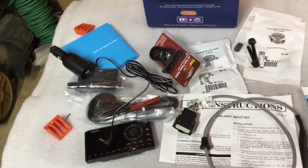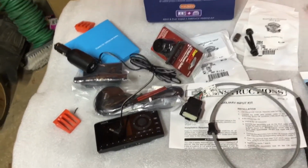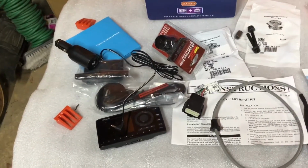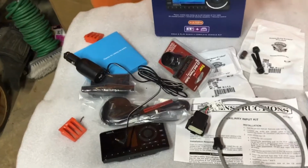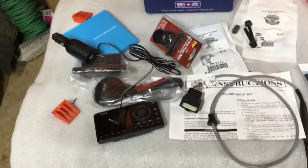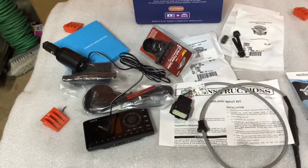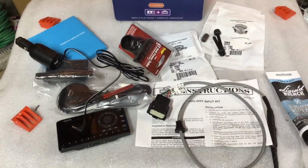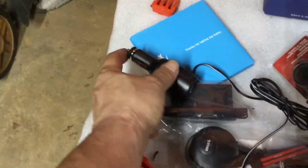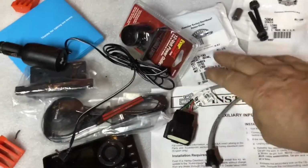And on my 2009 Road Glide, when I installed this basically the same way, I just tapped off on the 12 volt, well, they call it a power outlet. It's the cigarette lighter in the fairing to power the satellite radio, because the jack is 12 volts, but the cord itself going to the docking station, I think it's 5.5 volts. So I could do one of two things. I could take the housings off of this and just hot wire it right to the thing, or I can put one of these inside the fairing.